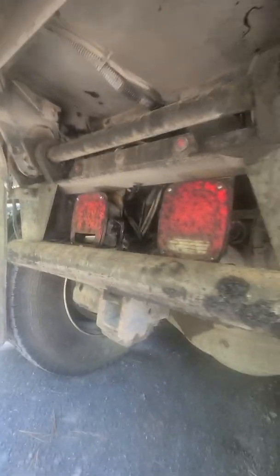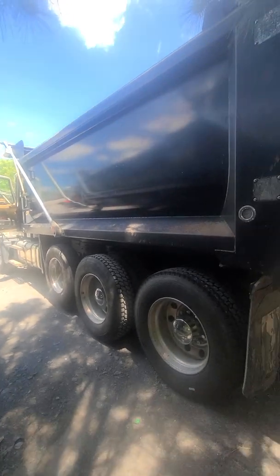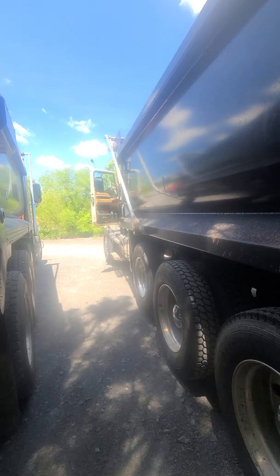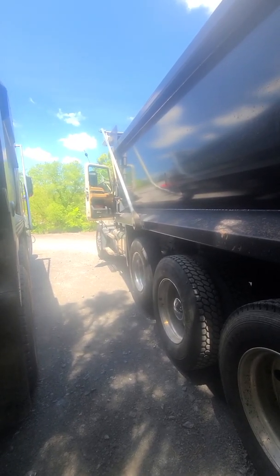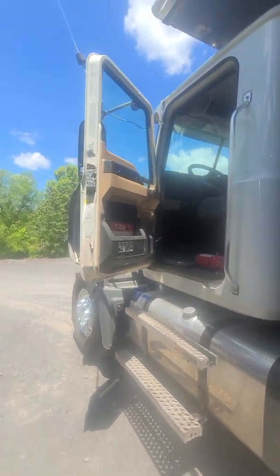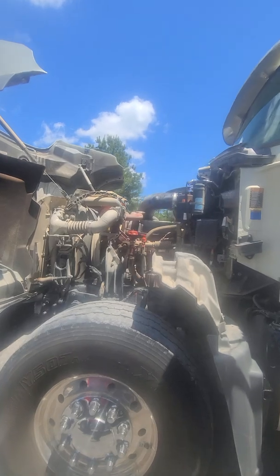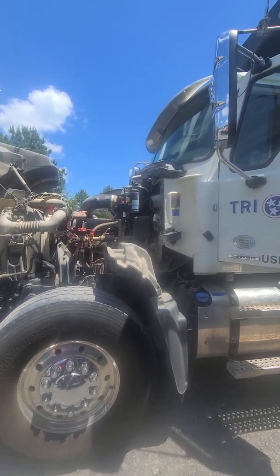And you start looking at your exterior. Okay, you got a little messed up right there. Like I said, you want to make sure this bed goes up and down. Most important thing, in my opinion, though, is that oil. Check that oil. See how clean it looks. Now, you might want to go ahead and send the oil out for a sample. You get with any lube place, any place that sells oil, like a major place, and you get that oil sample back, and that's gonna tell you so much about the inside of the truck, which is really the most important.